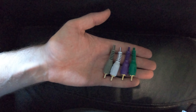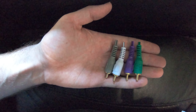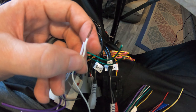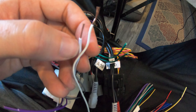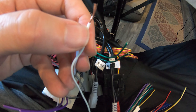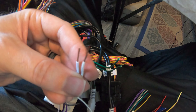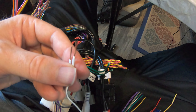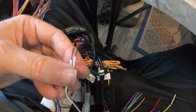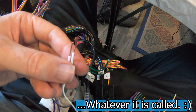As mentioned, I cut off all of the heads of those wires. It is scary to do but it must be done. Do be careful as you're stripping these wires because the insulation on one of these cables is actually slightly bigger than the other, so you want to make sure you aren't cutting your wire away as you're stripping it. Make sure these are cut about the same length, then twist them together and follow the instructions on the back of the stereo radio wire harness connector kit.